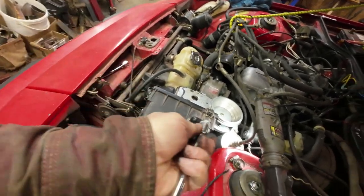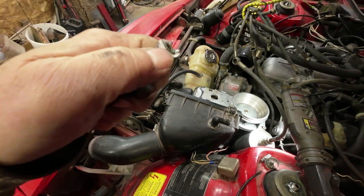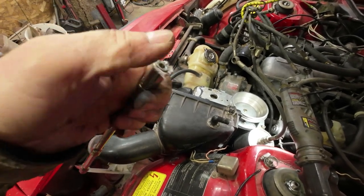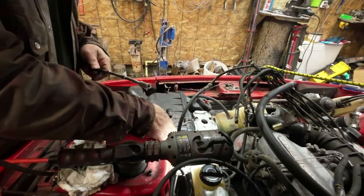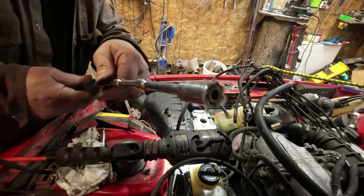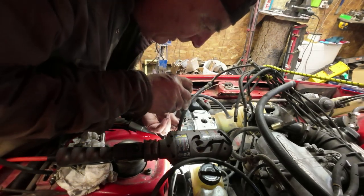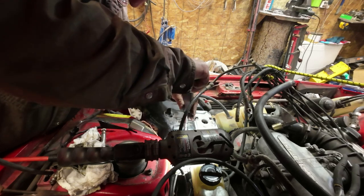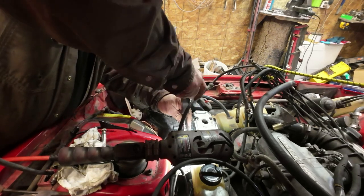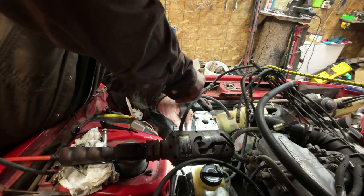When you want to get something into there, just take a piece of paper towel and put it over the socket and then put your nut in there and it holds it. It won't go anywhere. And then you can get it to screw on for you, maybe. Wait a minute, I'll show you. Yeah, where am I looking? Down around here somewhere? You can't really see anything, but here it is. And then just reach way down there with this thing and there you go. And that's on there. How do you like that, eh? Thanks, Sam. That works good.